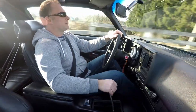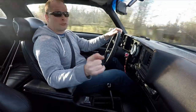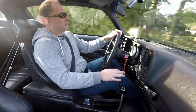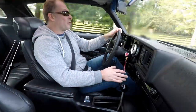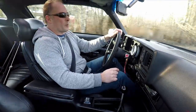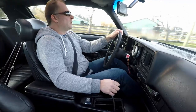A little rev limiter — that's what happens when you're not staring at the tach and you're staring at the fire truck in your rearview mirror. Don't do that, by the way. The rev limiter is 6,700 and I don't feel the car dropping off at all. It's probably as high as I'd want to wind this thing with a cam in it and the head flow out of these 317 heads. Honestly, it doesn't lay over at all. The bottom end is built — I got ARP everywhere, factory rods in the Gen 3 motor but it's ARP'd. So I think 6,700 is okay.